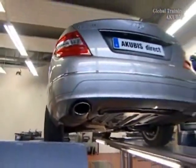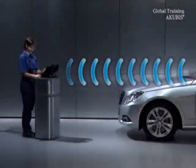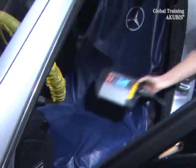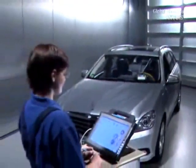The wireless signal and connection quality can be affected by obstacles such as parked vehicles or a car lift. If you can't work close enough to the wireless router, we suggest a direct connection with the star diagnosis system. Do not place the wireless SD connect in the footwell of the vehicle or on the driver's seat, as a good connection quality can't be guaranteed. The best position for the device is on the dashboard or hanging on the side mirror.